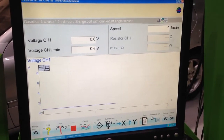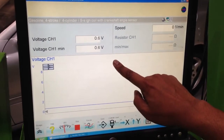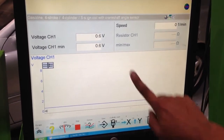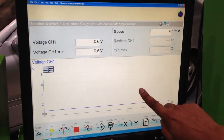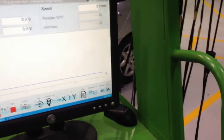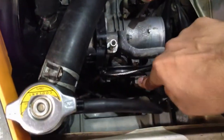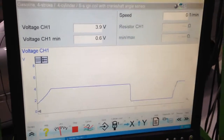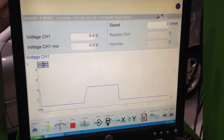When I snap the throttle open, the waveform should go up; when I close the throttle, it should go down. Each time you snap the throttle, you should see a smooth change — there shouldn't be any glitch in between. Let me try: I'm going to wide open throttle all the way up, then down, going up, going down. For a better view I can adjust the Y scale back to 5V, which would be ideal.